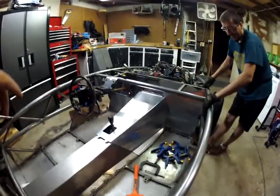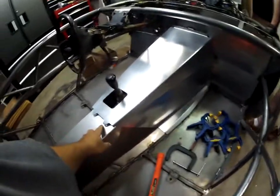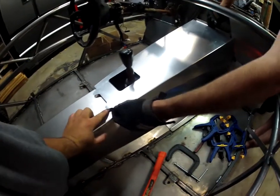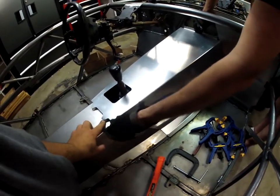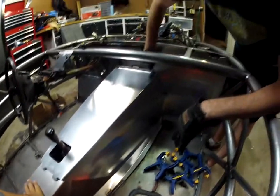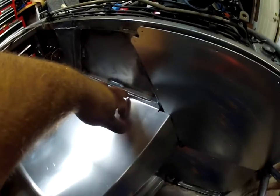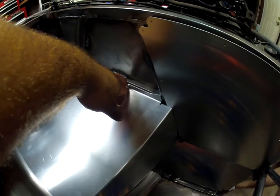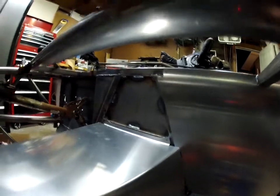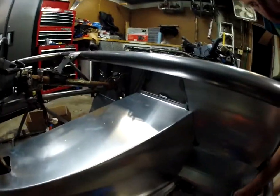One of the main problems is our centerpiece here. We have like three quarters of an inch of clearance between the welded-in tunnel - and this is welded in from the factory - and the aluminum one. But then if you look here, it's totally butted up against the frame, it's flush. It does not get any more hella flush. So what we were thinking is that this 90 degree here has to go on the far side, like the engine base side of this tube, where it goes down on the outside of the tube.